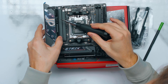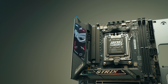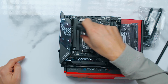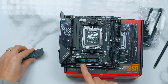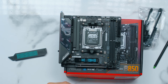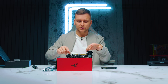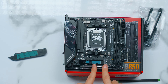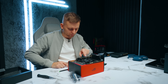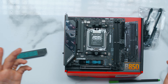There's some VRM cooling on the side with an active fan blowing downward — remember to take the sticker off so airflow can push through and out from the side. Looking at the M.2 slot: there's a heatsink with thermal pads on the top and bottom, which is needed since this slot is PCIe 5.0. The box includes a plastic spacer for SSDs smaller than 80mm so you can fit a 40mm or 30mm drive. It uses a quick latch system, though you still need to remove the heatsink screw.